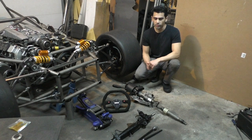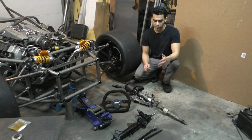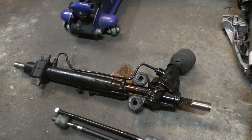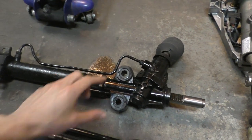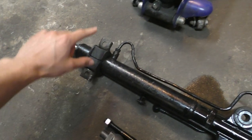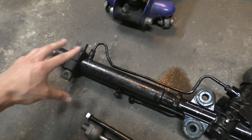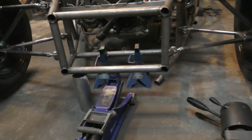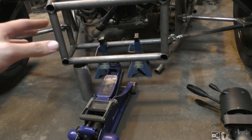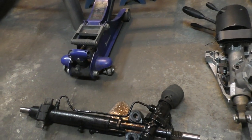There's definitely a lot of work to do for this video. Let's get started by mounting the steering rack. For mounting the steering rack I'm going to start off by making a few brackets that are going to bolt to the mounting points of the steering rack — there are two bolting points on each side. Once those brackets are made, I'll put the steering rack in its proper place and use those brackets to add additional tubes to hold it there.